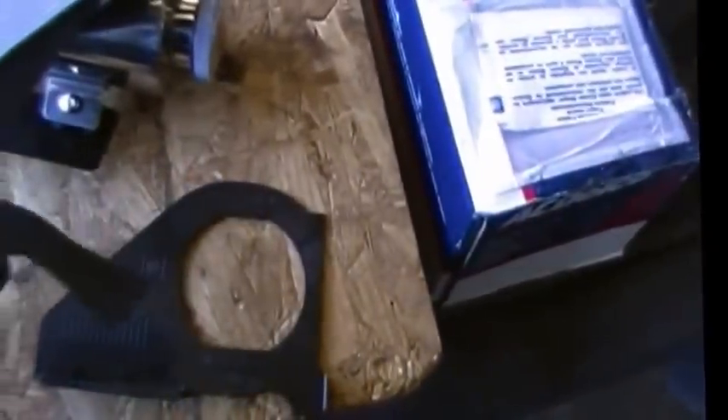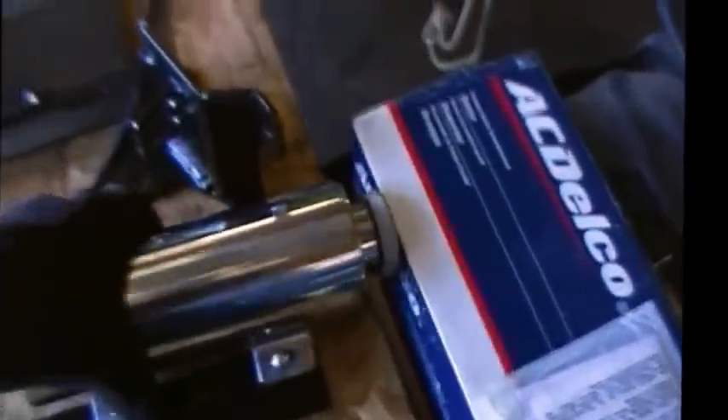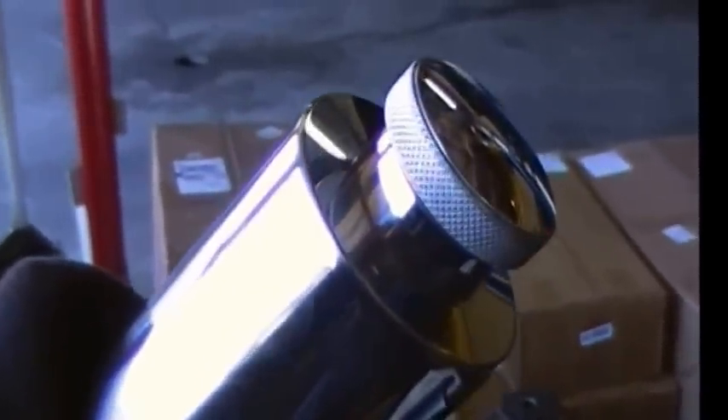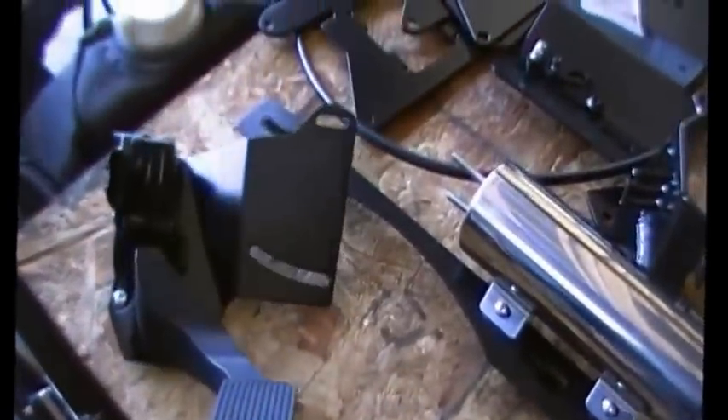These are the plastic shields that go around the starter and the opposite side of the bell housing to seal it from dust. Here's our coolant bottle, already mounted on the coolant mount bracket. This basically just slides into the factory fan shroud — no drilling, cutting, or hacking, just slide it in. This is a stainless steel bottle, not aluminum. We found the aluminum bottles would oxidize and gall, so we've had no issues with the stainless bottles. Here's our accelerator pedal — APP, accelerator pedal position sensor — mounted on the Motec bracket.